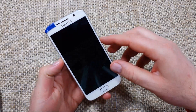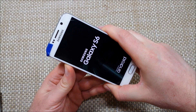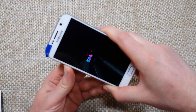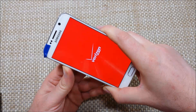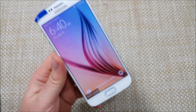We're going to start off with the phone turned off. If the phone is turned off, you're going to press and hold the power key for a few seconds, then let go and hold the volume down key when the Samsung Galaxy S6 screen comes up. Keep holding the volume down key until the phone boots up all the way, which can take about 30 seconds to a minute. At the bottom left corner, it should say safe mode — so right here it actually says safe mode, meaning you're in safe mode.